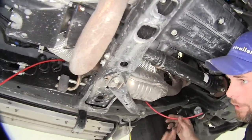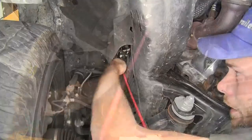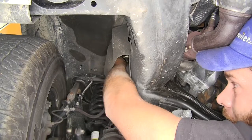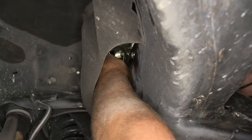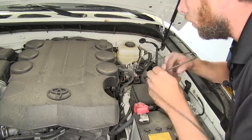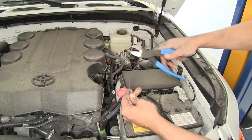It'll come out right up here by the exhaust — we want to keep this behind the heat shield. Keep it in that area, right above our frame. Then run up through those couple coils in the brake line there and guide this towards the front driver side of the vehicle — that's where my battery is going to be located. Right here you can see a small bracket that anchors our brake line; I'm going to use that for another anchor point. Here you can see where our pull wires come out — pull that on up and make sure you get all the slack out. You don't want any coils hanging down there. Take about an extra 12 inches or so and then snip it off.